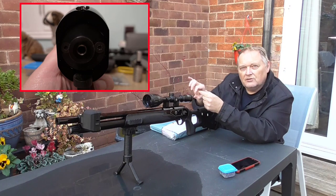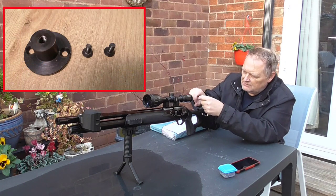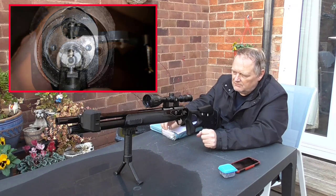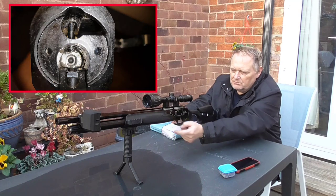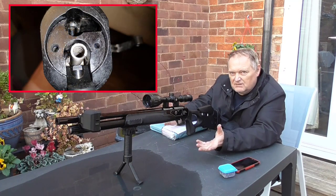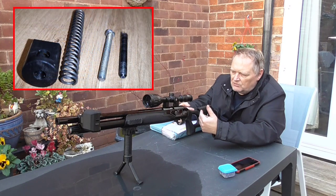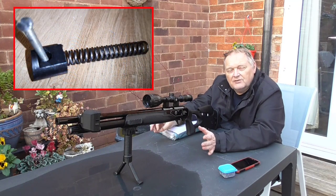So there's a screw either side of the cap that needs to come off, and they're Loctited in, so you need to use a blowtorch for that. You need to use a blowtorch on all of them, on the top, underneath, and on the sides really. If you're drilling the snap-off cap top and bottom, you don't need to put the heat on it. But if it's Loctited in as well, you will. Basically, take that cap off, and once that's off, you take the bolt out, and then you can replace it with an M4 bolt.